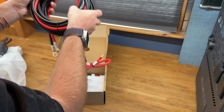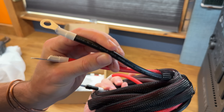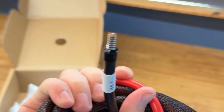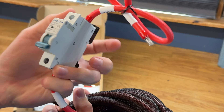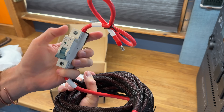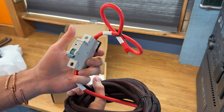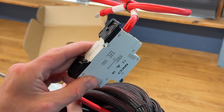And the cables. This is your main alternator cable, and compared to most cables I look at for these alternator chargers, this is considerably thicker than usual — six American wire gauge. They've even done all the terminals at the ends already, so you can just insert and screw down. Interestingly, instead of a fuse — which you normally see and is sometimes a bit too large for the cables — they've gone for a breaker, a DIN-mounted breaker, which seems a bit of an odd choice.